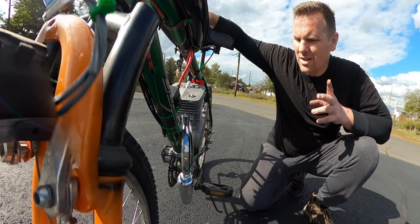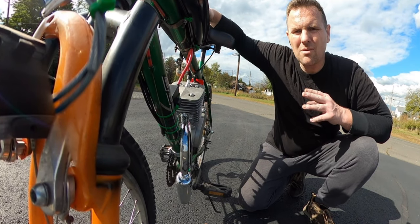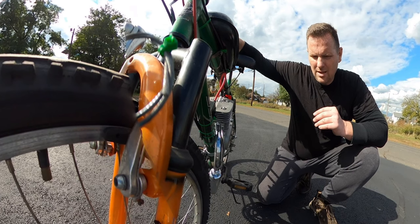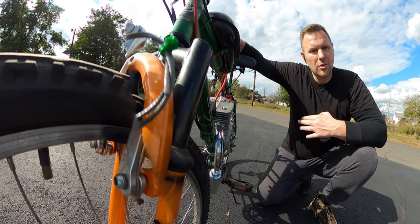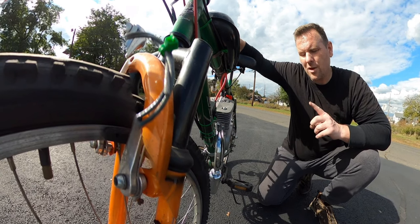And that goes to show you, when you get a messed up motor, something that's not running right, sometimes it's the simple stuff that you don't even think to look at. And the way it was acting, there was no doubt in my mind that it was a timing issue, because it doesn't backfire through the carburetor because it's not fueling properly. If it's fuel, it will backfire through the exhaust.